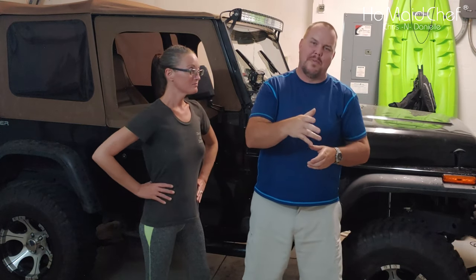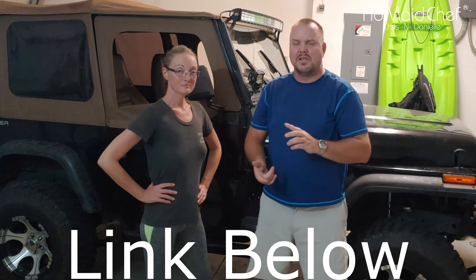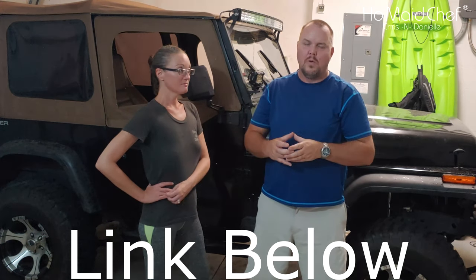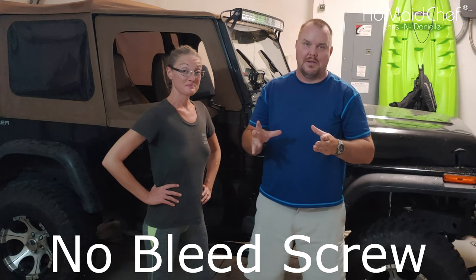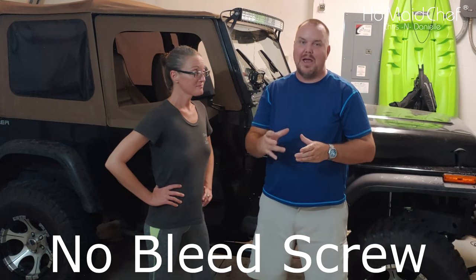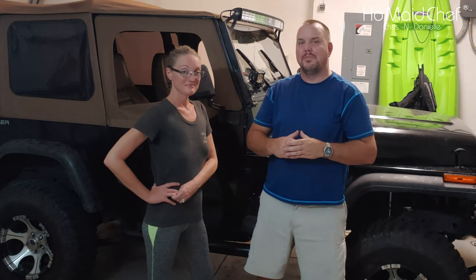Okay, so the Jeep, you might have remembered we replaced the slave and master cylinder on this with the pre-bleed kit. Well, after an accident, it kind of got unbled, so we had to bleed it again. The thing is, with the clutch master cylinder set up on a Jeep like this, there's no way of bleeding. So in this video, we're going to show you how we bleed it and get the air out of the slave cylinder so the clutch works again, which is awesome.